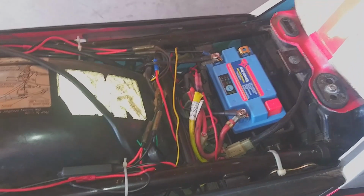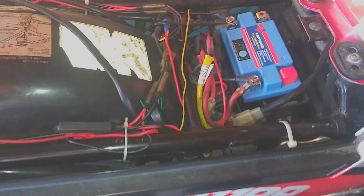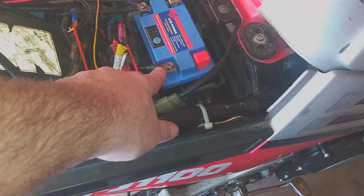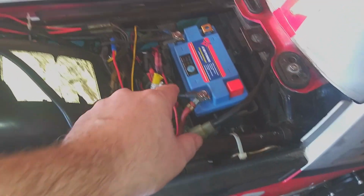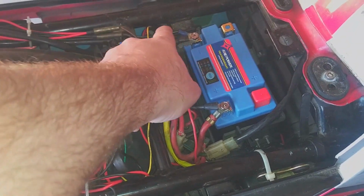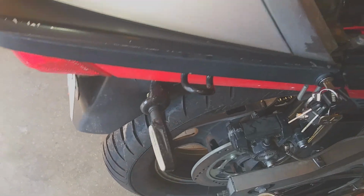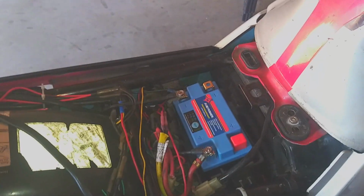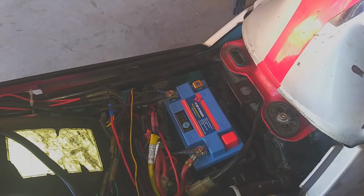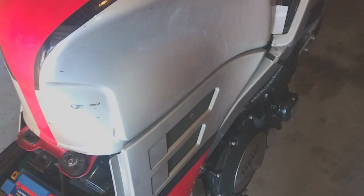That's going to be a big project for the weekend, so I'll be ordering wiring and high quality connectors. I'll be merging these two together. This is for the ignition. Like I said, the wiring for the ignition system is dedicated. Then we just have a cheap little accessory here. I bonded the tail lights a little bit better because I upgraded to sequential LED tail lights, and I didn't like the ground that I was getting. It wasn't a good connection. But you also notice, I've got this. I'm putting one of those on order so that we get the tank taken down.